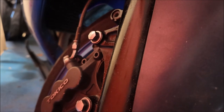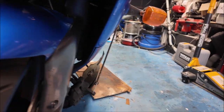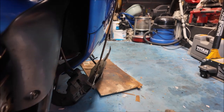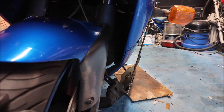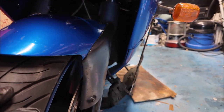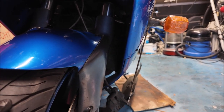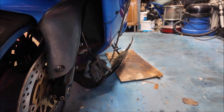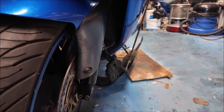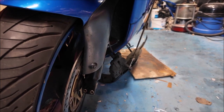I won't pump the brakes yet because I've got the other side to do — if I pump it I risk pressing a piston out. So I'm going to change the brake pads on this side, bolt it back in, then give the brakes a pump up, make sure it feels good, and then it's just a test ride. Got the belly pan to put back on and then it's MOT and back on the road again hopefully. Thanks for watching — let's get on with it because I'm losing light. Catch you later, bye!